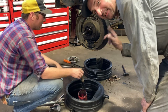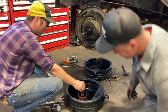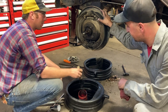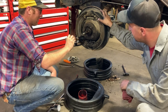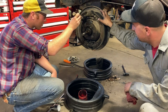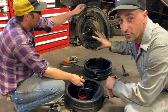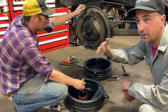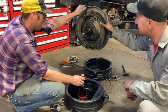There's a 100% chance that this is asbestos brake lining material because this brake job was probably done 75 years ago, before the Second World War. What we do when we encounter old brakes like this is just wet everything down really good with some brake cleaner or similar. Avoid blowing it — just rinse it away and try not to have your lungs intake any, and then you're usually pretty good. This is just a giant version of the same wedge and same rollers as the 32 Ford car. If you're interested in how mechanical brakes work, we did a video on a 32 Ford — theory of operation. This is exactly the same, just three times the size.